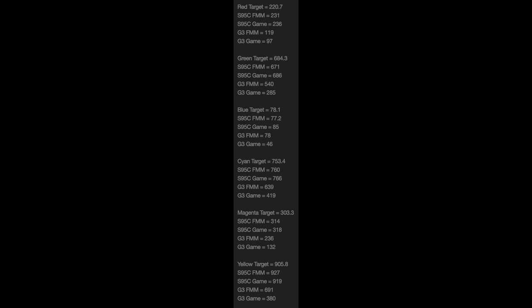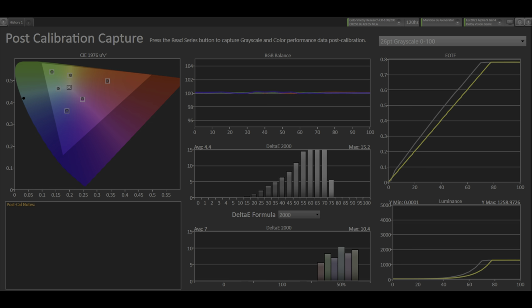Going higher — up to 70% or 75% stimulus measuring P3 — in game mode the color luminance is not boosted the way it is in non-game modes. So as colors approach the outer edge of the P3 gamut at high brightness, game mode shows a significant and quite visible difference compared to being outside game mode. This discrepancy has always existed in previous models to maintain low input latency, but on the G3 the difference is much larger and more noticeable. Dolby Vision game mode cannot be made accurate even with calibration and is not recommended.